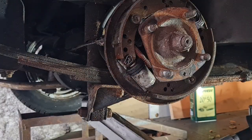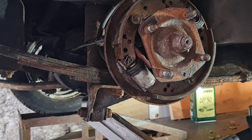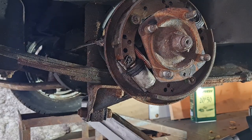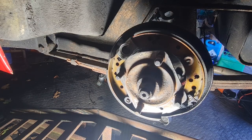This rear brake is exactly what I thought - it is a new cylinder and it is working, so that is absolutely great. I've bled the front now - pushing the pedal you should see that cylinder move. Yes, it is working absolutely perfectly. So I'm going to get around to the other side of the back now, check the other side, make sure that's working the same, and obviously bleed it as well so it's got fresh fluid all the way through.